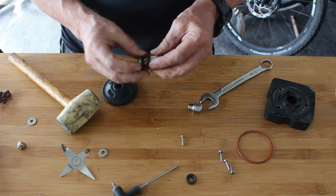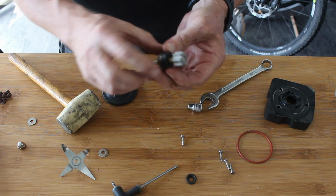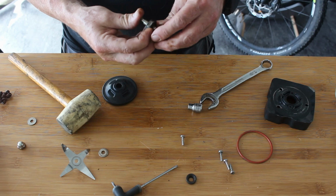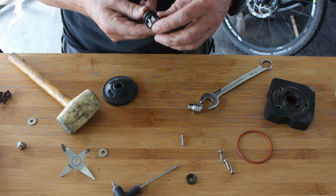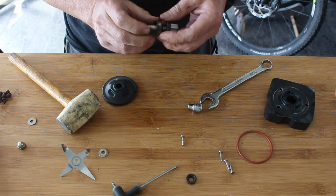It sounds terrible. There's stuff been getting down the inside of that seal there, getting into the bearing, and it's been eating it, and it's not in particularly good shape. So we've also got to work out how we're going to get that off the shaft as well, because I've not thought about that. That's going to be an interesting conundrum.